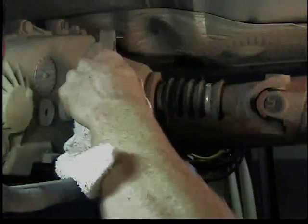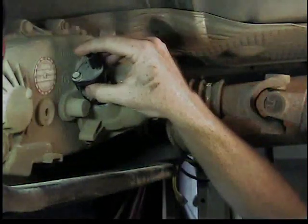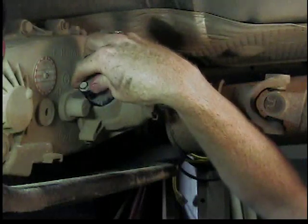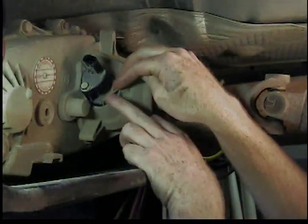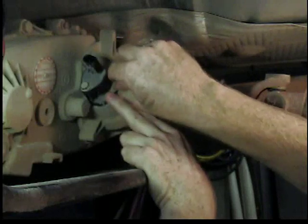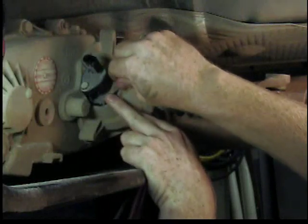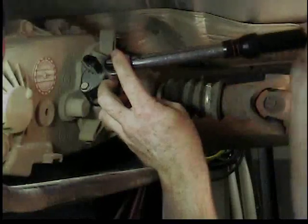Before I reinstall, I'm going to wipe the hole in the transfer case clean. Then I'm just going to press the speedometer sensor assembly with the new gear on it back in. I hold my thumb on the number range that I want installed down, in the 6 o'clock position. Once it's in there, you can rotate it a little bit to line up with the clamp. The clamp fits into some grooves on the case — there are four different positions you can press this in. I'll tighten the bolt and torque it to between 90 and 110 inch-pounds — I did about 100.